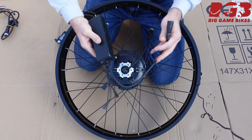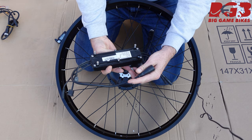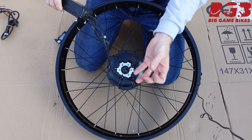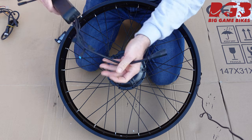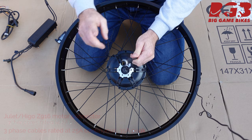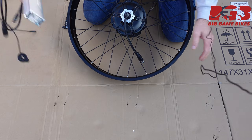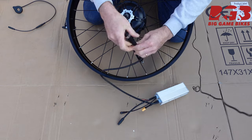This is the standard controller you're probably familiar with — this is off a Rad Runner. The three motor core wires on this particular Bafang connector are not as thick. This one can handle 25 amps continuously, whereas the new one can handle 35 amps continuously. So let's look at all the parts that came with this kit, connect them all together, and give ourselves an idea of what's going on.